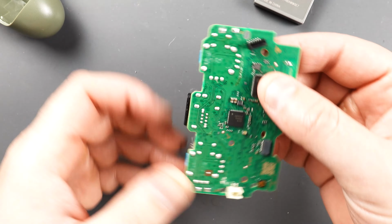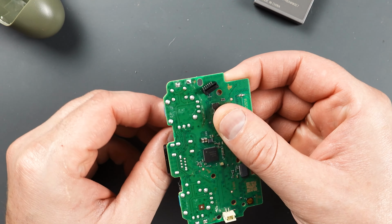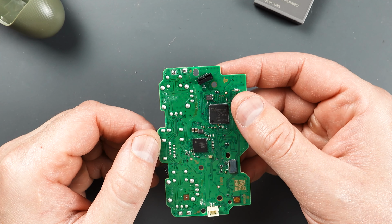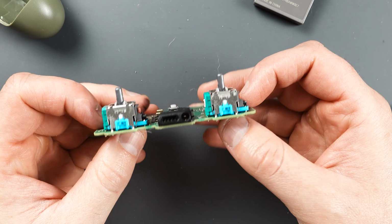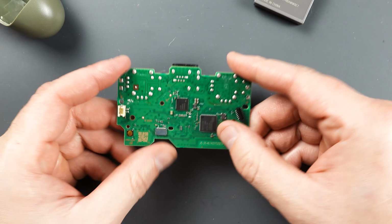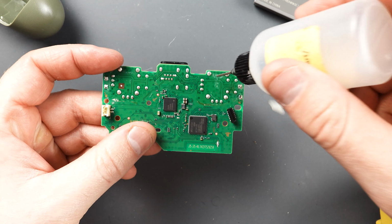Alright, so what we got to do is desolder these thumbsticks off here. I do have an Xbox video where I showed you how to do this with solder braid, but in this video I'm just going to go ahead and remove it with my desoldering gun. If you want to see how I did that, I'll put the link in the description. So we're going to go ahead and put some flux on there.